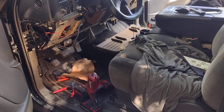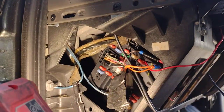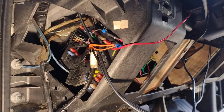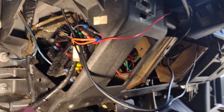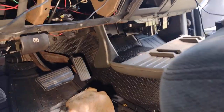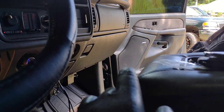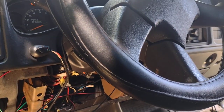The ground feed is still in the plugs on both harnesses. So all you have to do is keep the ground in there, take the thick orange out, the small orange out, and the dark brown wire out. On the passenger side all you need is the thicker orange and smaller orange. Today I'm going to be running another wire from the smaller orange to the smaller orange on the passenger side, to on-and-off with the key. Without that data link the module does not communicate with the other modules.